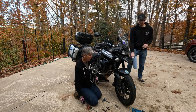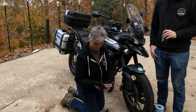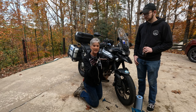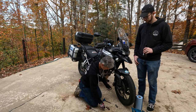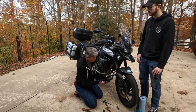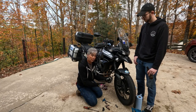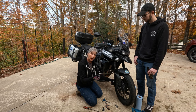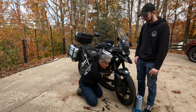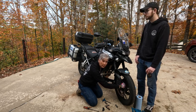When you take your brake pads out, make sure to watch if there are any spacers on the backs or if there are any clips. There aren't any retaining clips or spacers on this one. Now we need the new brake pads. Shiny new brake pads! New brake pads, old brake pads — you can see the difference in the thickness. Now you've got the brake pads out, you want to clean your calipers and inspect them — make sure everything's good. Another thing you need is a Scotch-Brite pad and your brake cleaner, and you're going to clean off your rotor so that it's a nice, smooth, clean surface and get all the old brake material off of it.